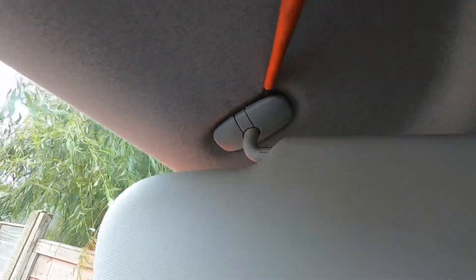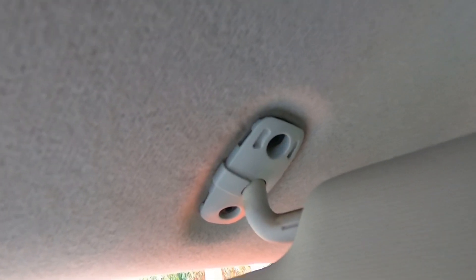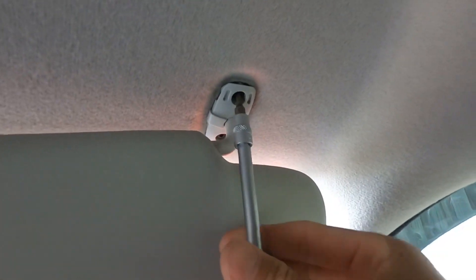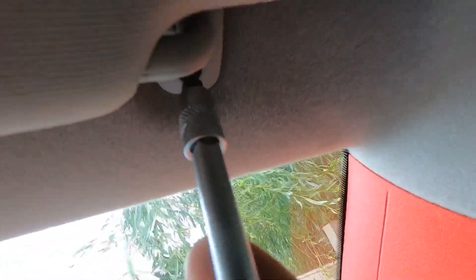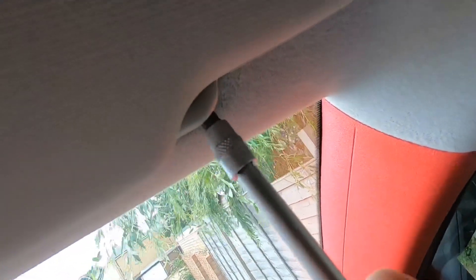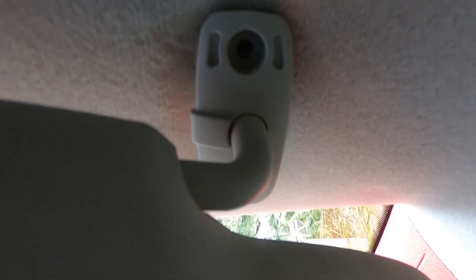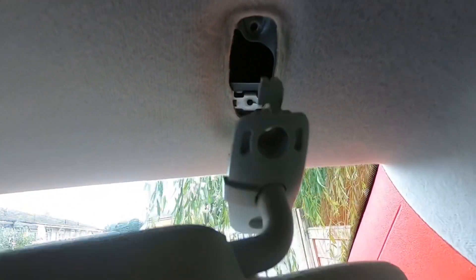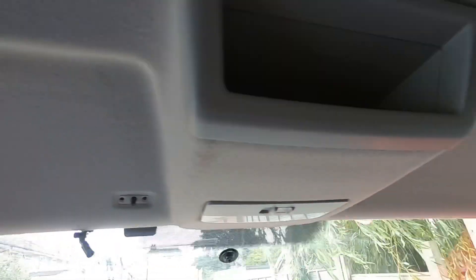There we go, that one's popped out. On the other side I'm just going to slide my screwdriver in and give it a little turn motion — like so, that's popped out now. It's quite hard to take that off without doing a tiny bit of a mark, but that'll be fine when I've colored it — you won't even notice it. I'm just going to unscrew the Torx screws on this side as well. Make sure you put it forward towards the windscreen gently and release it. So that's both sun visors out.